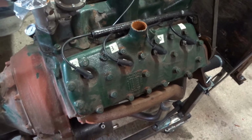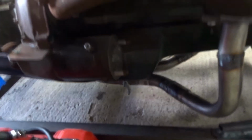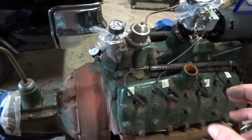And then I'll probably pop a little bit of oil down each bore. I'm using a high zinc oil. I've already filled the engine up and nothing's leaking out onto the floor. Do you remember I fitted that copper crush washer under there, where the oil bleed plug was, and that seems to be working.